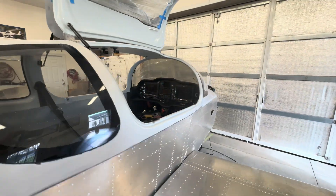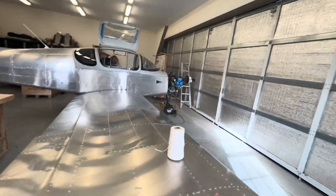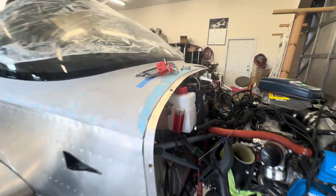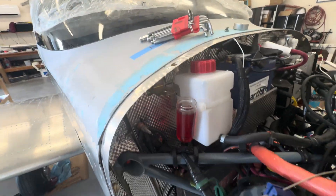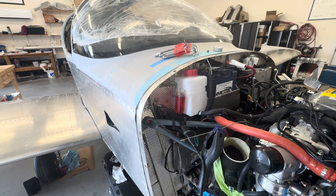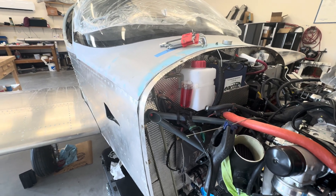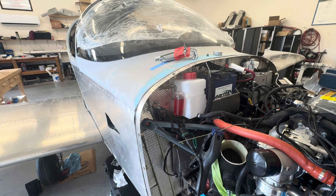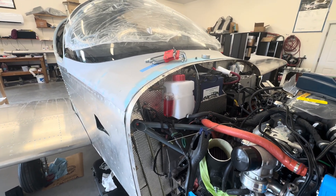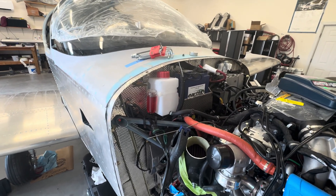I just kept switching from gear leg to gear leg, figuring any bubbles I couldn't see I would push through. I sucked it out and did another syringe — two times on each gear leg, maybe three: two on one and three on the other. I'm not seeing any bubbles now and the brake seems tight, so I'm going to stop there and see how it does.